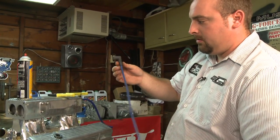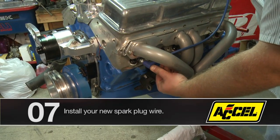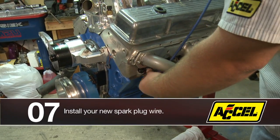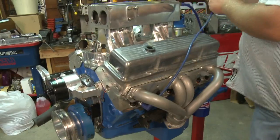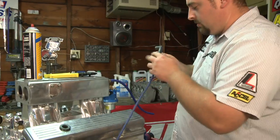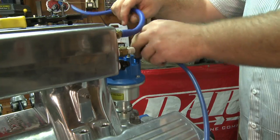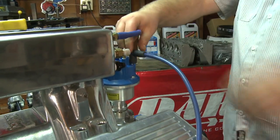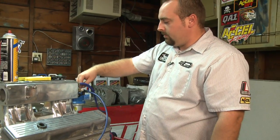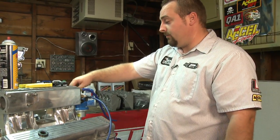And that would be how you cut a universal wire. Next step is to put it on there — it usually clicks on, sometimes they snap on depending on how new the terminal is. This one is number one cylinder on a small block Chevrolet — we have number one marked on our cap. Push it on down and it clicks right on. You would do that consecutively with the other wires, one through eight, in the correct corresponding firing order of your motor.